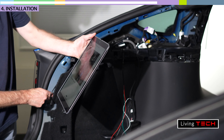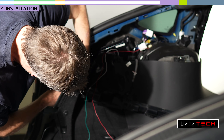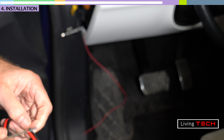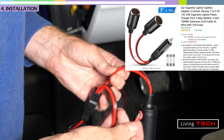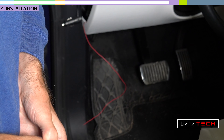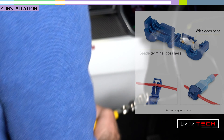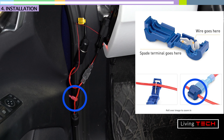This lug we're grounding to here — looking at this edge. That red wire is the wire I ran up to the front; it was pretty easy, just under a couple of panels. Instead of splicing right into that OBD2 cable, I got a Y connection for a 12-volt cigarette lighter type receptacle. I put the Y in so that I could splice into one side, and then the other side could just continue into the Blackview 12-volt plug. That worked well — it literally took me about five minutes to hook this up. I just stripped that wire back, crimped a spade connector onto it, and that spade plugs right into that splice that digs right into the power wire of one side of the Y.